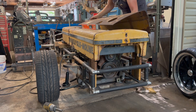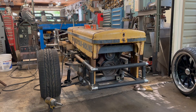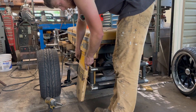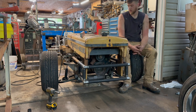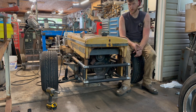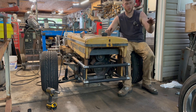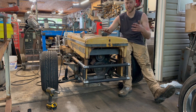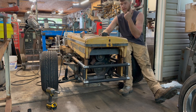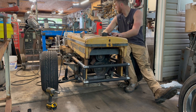I'm going to try to hang this on. I'm going to have to do some trimming on some sheet metal, but not much. It's like playing Jenga. For once you can actually see what this thing's going to look like. Then there's these side skirts, whatever you want to call them, that I will have to cut to length. Things are going to look tough. Now that we got all that figured out, I need to order a drive shaft, which I can measure for now that my transmission's mounted in place. Dad has to machine the ends of my wheel hubs because the centering hub is like an eighth inch too big for the wheels I got — I swore I checked that but apparently I didn't. So he's going to machine those down this week so I can next weekend assemble the rear end and get it sitting on the wheels. And then I need to get a sheet of 10 gauge and a half sheet of 14 gauge for various things. I've got to try to find a radiator that will fit in here, which is going to be tricky because it's not a very big space, but we'll do what we got to do.